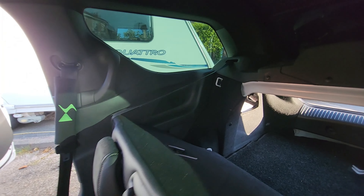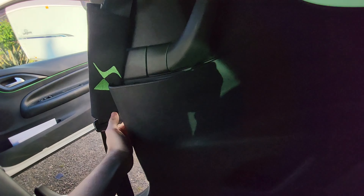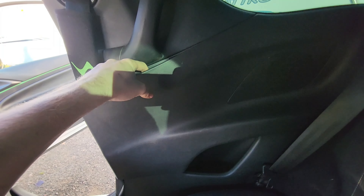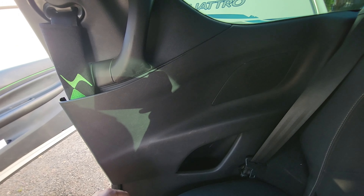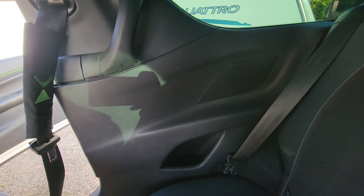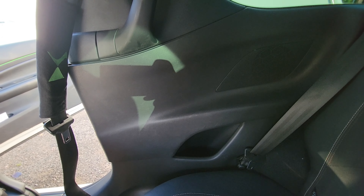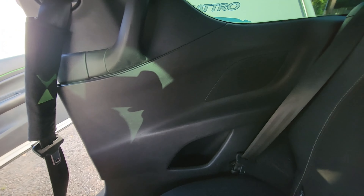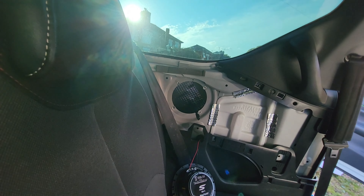You don't need to actually take the seats out. I also have a spare set of clips - if you don't, please be more careful because the clips break fairly easily and you don't want to put it all back with broken clips, because that's when you end up with more rattles. Especially if you're fitting a subwoofer, there's going to be even more rattles, so that's definitely not what you want. I'll cut back again when this is off and show you it looks the same underneath.